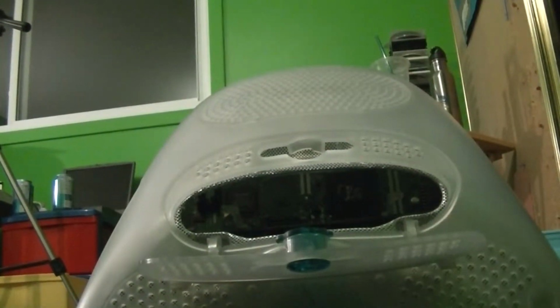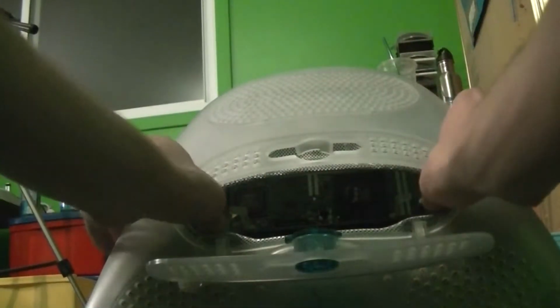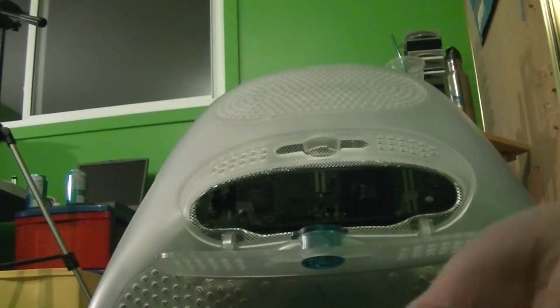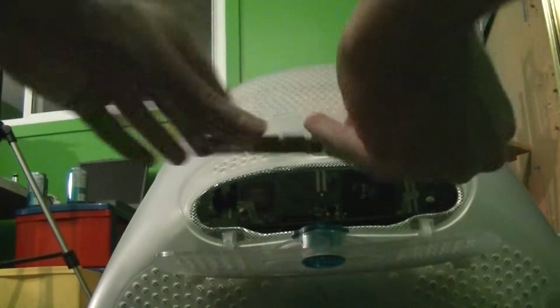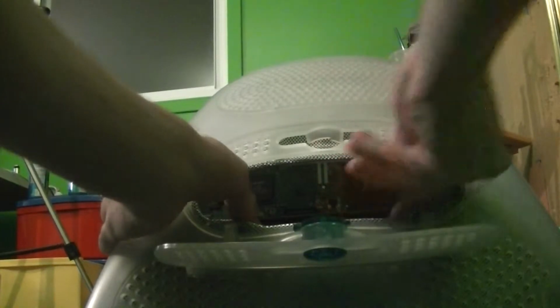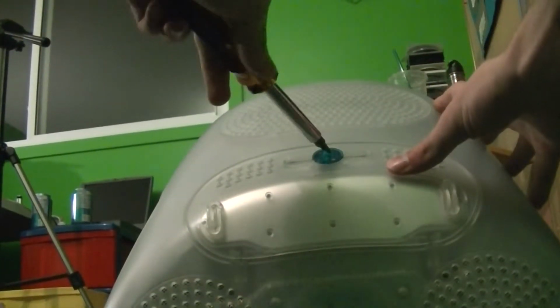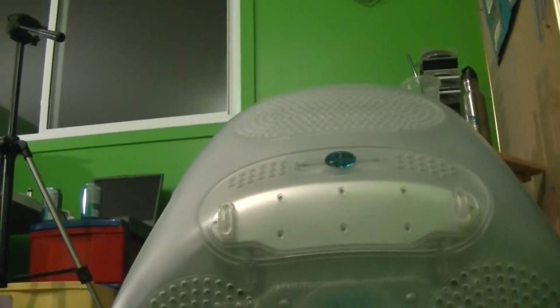Alright, you could do the same thing. Actually, you could put your old memory stick back into the package that is now vacated by the new one. You could take your second package. This one happens to already be open. Take out the module. Put it into the case. Take the new module. Put it into the Macintosh. And then when you're finished with that, close this up, lock it, and put it back where it needs to go. Now, how easy is that?